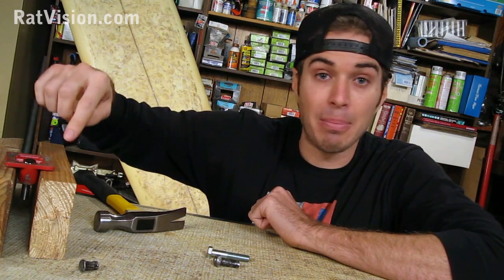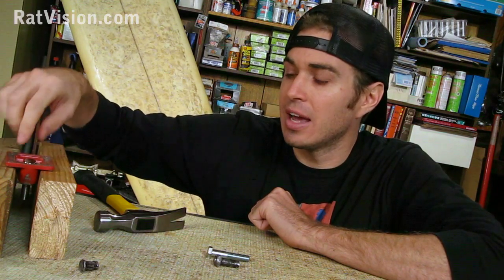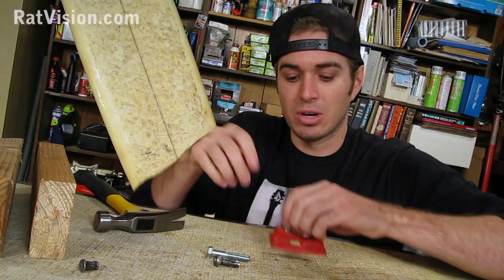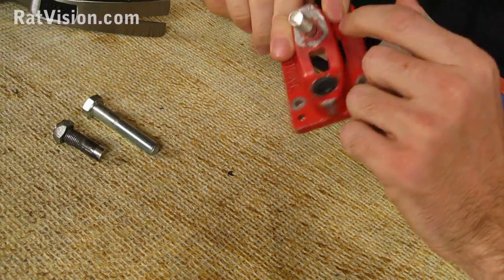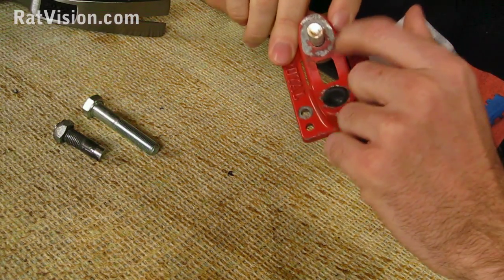So what can happen is with all that hammering and all that pressure, the base plate can crack where the hardware goes in, and it can also crack in the center. Now what you want to do for these newer ones is put all the pressure, when this thing is going in, around the kingpin and just on the really heavy part of the base plate.